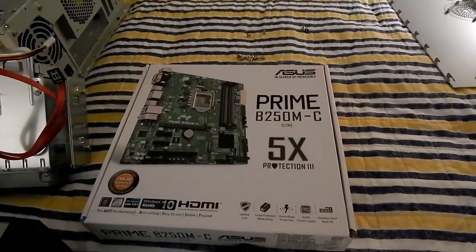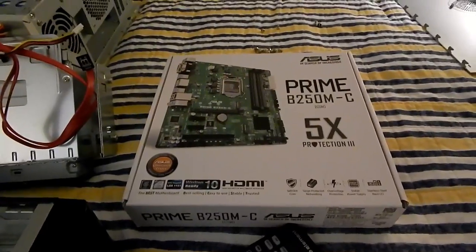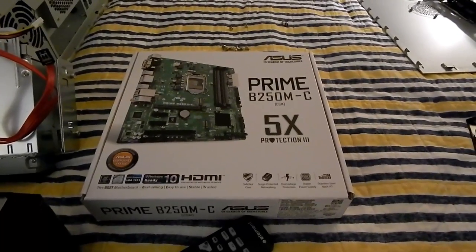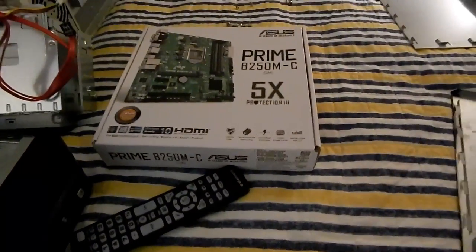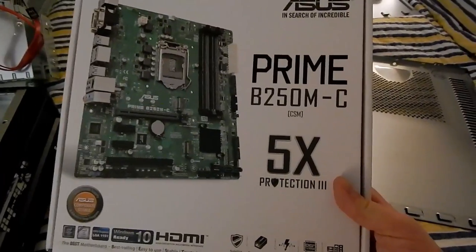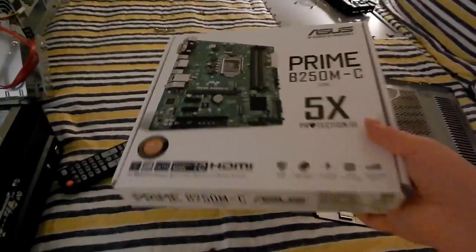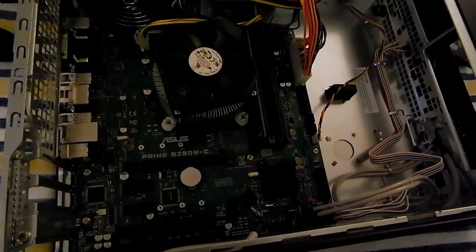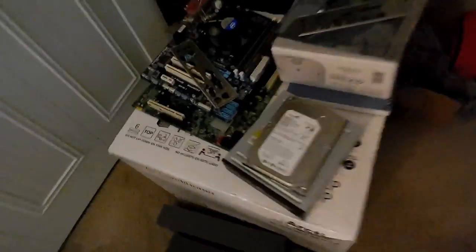Here's what's going into the Prime Systems computer. Funny enough, I was talking with UXW Bill the other day and said I should get Amazon Prime to buy this Asus Prime motherboard to put in the Prime Systems computer — well I'm two-thirds of the way there. It's a Socket 1151 B250-based Kaby Lake motherboard, part of Asus's corporate stable platform. So it looks like an ordinary OEM board you'd find in one of Asus's commercial desktops, very similar to the old board that came with it originally.